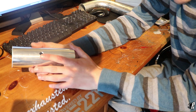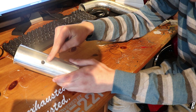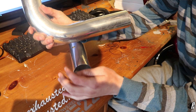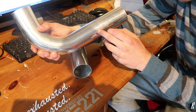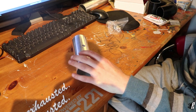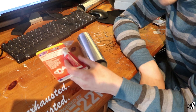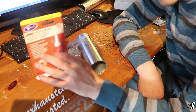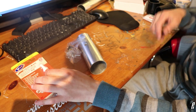I'm going to move the camera over here so you can see what I'm doing in a lot more detail with my hands. What we're going to be doing is installing the IAT sensor into the intercooler piping. I've already drilled and tapped an M12 by 1.5 hole into this intercooler pipe. For the idle control fitting I'm going to show you how to drill and tap — no point repeating myself twice.